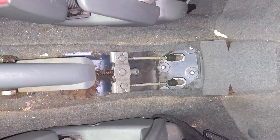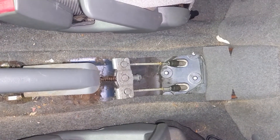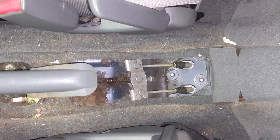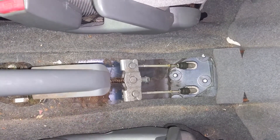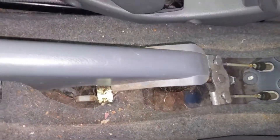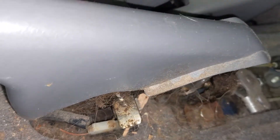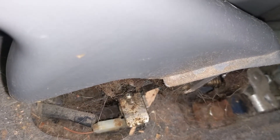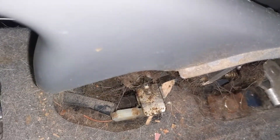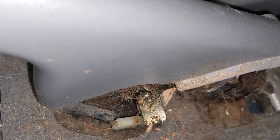When you pull this forward, it pulls on both sides, which closes the brakes back at the wheels. From what I can see it's sliding pretty good — they go in and out pretty easily with just a little bit of resistance. It feels like the issue may be up here in the mechanism. It engages right there on the first click — you can feel the resistance start.